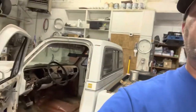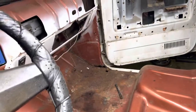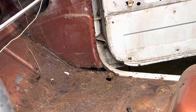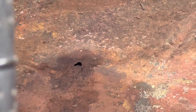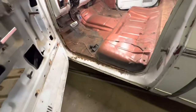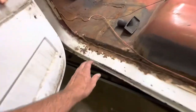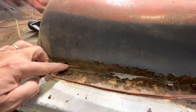Here we go, got another new project — we're gonna put some interior in this old truck. This is what we're working on: a 78 Chevrolet truck. The toe boards are a little crunchy, the floorboard is too. Got another hole right there, and on the driver's side this channel where the rubber lays into — that's gone. You can see how that's a little crunchy on the rocker panel.